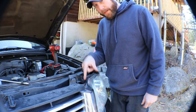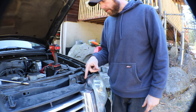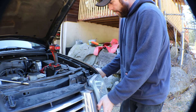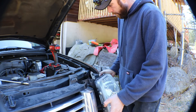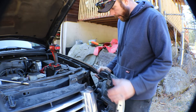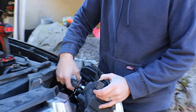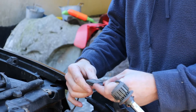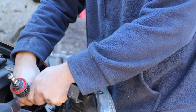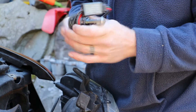All right, I got the two top bolts out. There's a bottom bolt down in there — you can see it's not too hard, you just need a long extension. That one you don't need to take out completely, you just need to loosen it. And once you loosen all that and take the two top ones out, it pretty much slides right out just like that. Here's an old style LED I have in here that was giving me problems. We're going to take these out and put our new ones in — they're pretty much plug and play. Just like that, you unplug them.